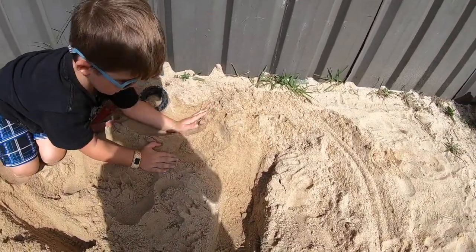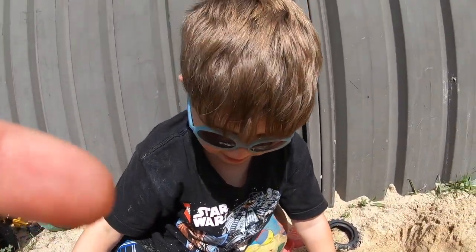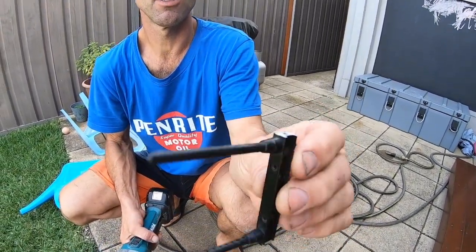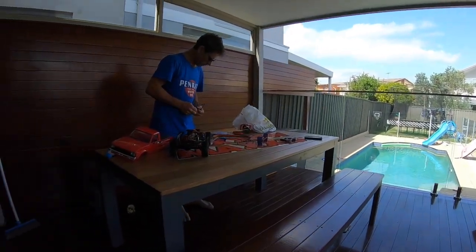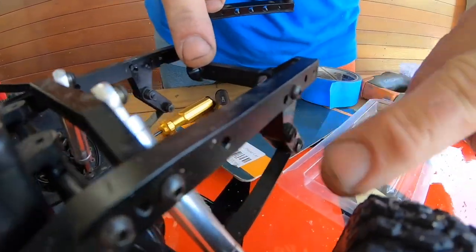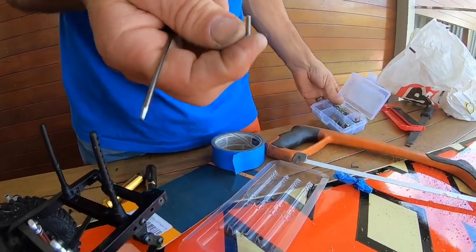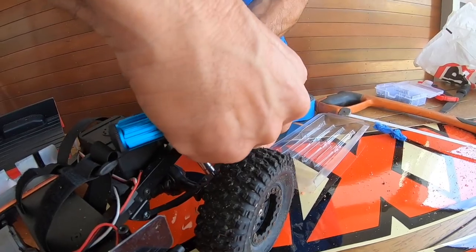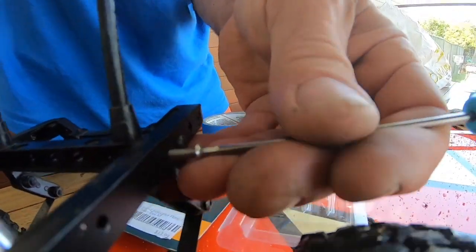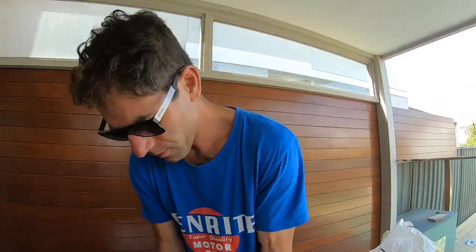So first you need to put this thing like that, and that like that. Put that on. Now I had to modify that cross member — it's a little bit too long where it was sitting on the chassis, so I've got to cut four mil off it. And then I need to find a longer threaded screw to put through it. So we've cut this cross member down, we've taken five, six mil off it. We've picked up the shackle bracket bolt. We're going to slip this in there so we can share it with the other bolt. We've found some longer stainless steel threaded rods that we have in the kit. We'll bolt this in and then we'll need two new holes here, but that's later. That's how we'll fix the cross member section. Too easy.